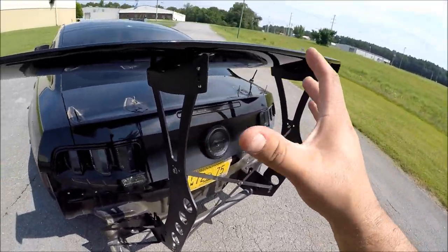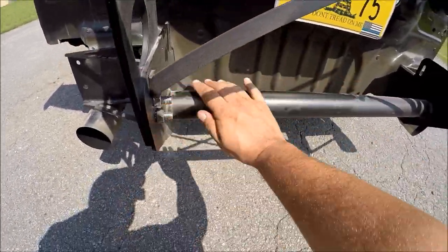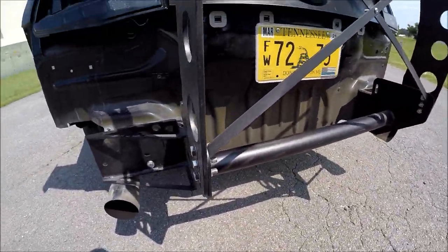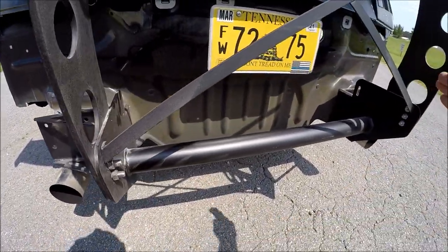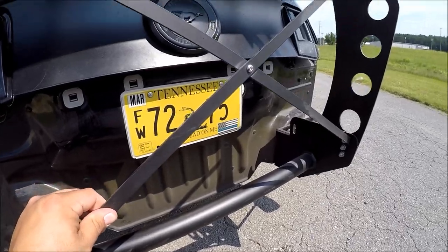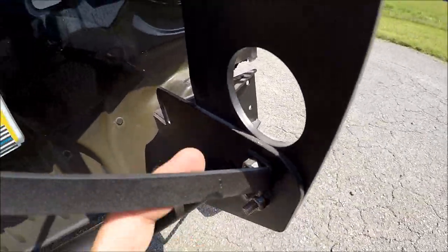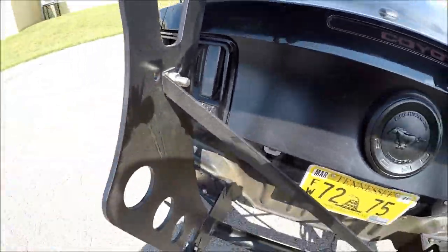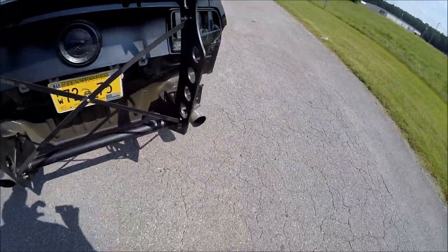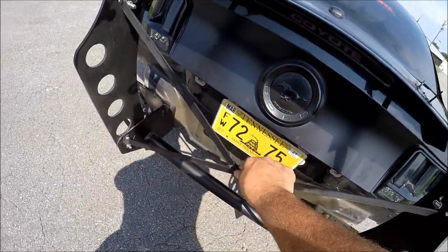After that, you're going to grab your brackets that hold your wing — these brackets right here — and they're going to attach to your crash bar from the outside. The top bolt screws onto this brace right here, and you follow that up to the middle hole, same thing on the other side. Top bolt screws onto this X-brace and goes up to the top one as well. After that, you secure two more bolts on each side. Then there's this little Allen bolt right here — you're going to use that to secure the middle of your brace.